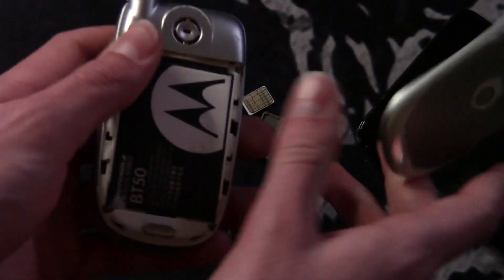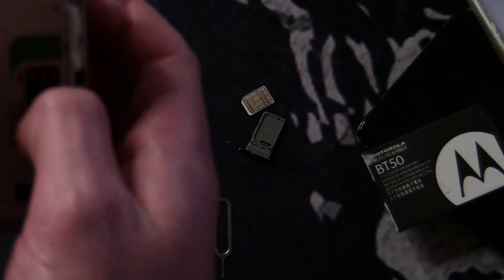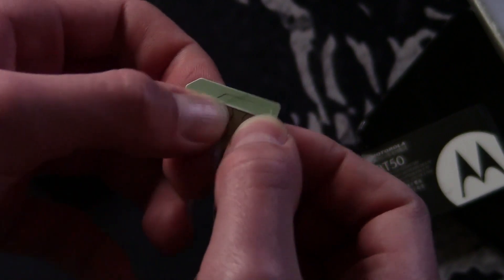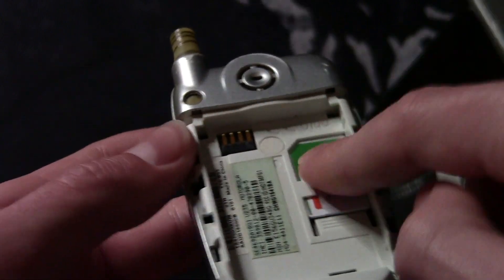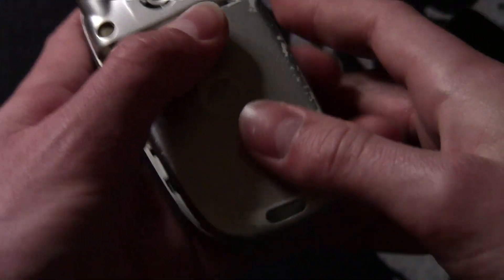After that, you're able to just swap that SIM into the flip phone and it will work. Get your flip phone, take it apart, and make sure you're using the largest SIM card size. Just stick that right in the center slot. Once you have it inserted, put it into the phone — they can have different insertion methods but generally it's in the back underneath the battery. Get your battery, slide it back on, put the bottom cover on your phone, and then power it up.